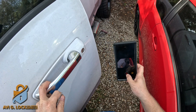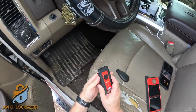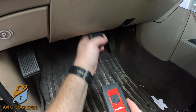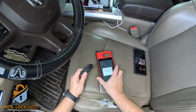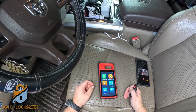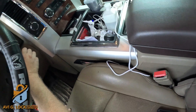Now we're going to program the key fob. I'm going to use the Autel KM100 — I'm going to connect it to the OBD port under the steering column, connect via Bluetooth, and hook it up to the app. I'm going to put the key fob in the on position in order to read the VIN number and communicate with the vehicle.